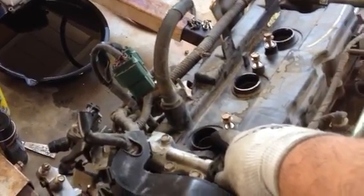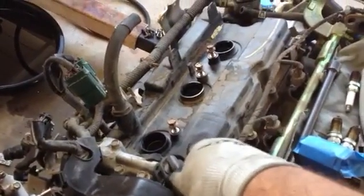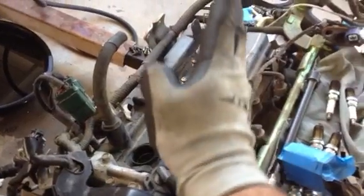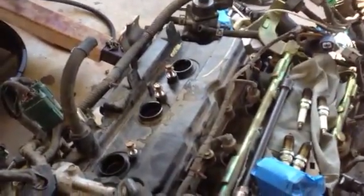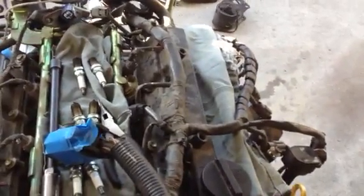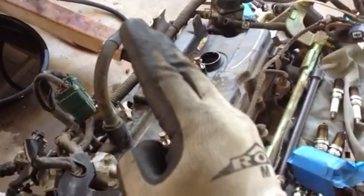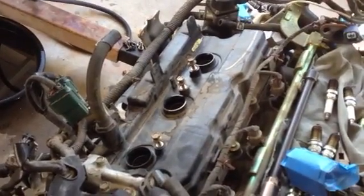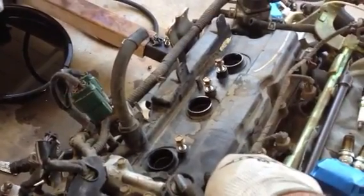The other thing you can do if you don't want to do it that way is remove your rocker cover and look at your camshaft lobes, and make sure they're pointing up and towards each other on this side of the engine. Both camshafts should be pointing up and pointing a little bit towards each other, and then you'll know that it's on compression stroke — that's if you actually visually want to see it by removing the rocker cover. Alright, I hope that clears a few questions up. Thank you.